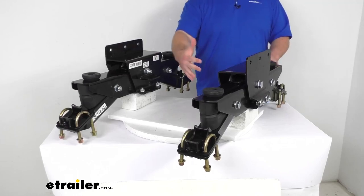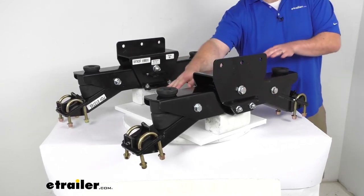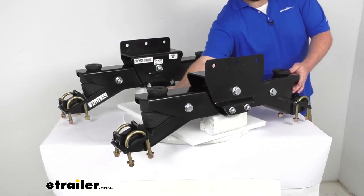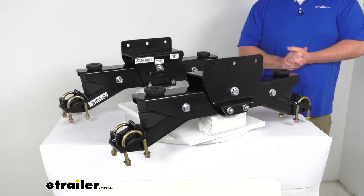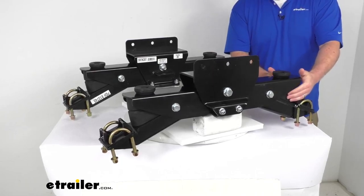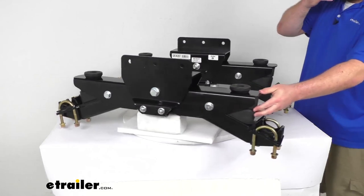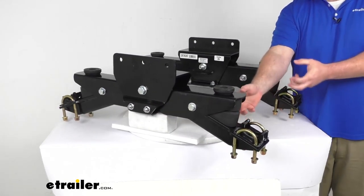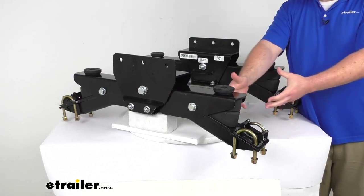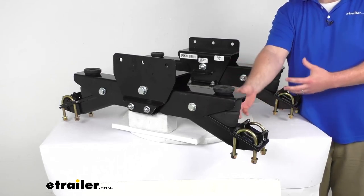There are several different components working together to provide that nice, smooth, quiet, stable ride. We've got the walking beams with a single pivot point that keeps weight distributed evenly between your axles for maximum stability. You've got pivoting arms that ensure all tires hug the road even on rough, bumpy terrain, helping the trailer stay level on uneven ground. You've also got double Aeon rubber springs that absorb road shock and support the trailer's load — they have a progressive rate spring design, compressing and becoming stiffer under a heavy load for extra support, and expanding back to their original size under lighter loads to act as a return device and minimize rattle and bottoming out.